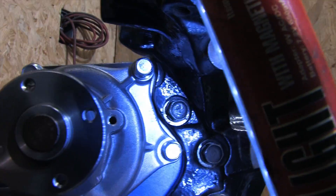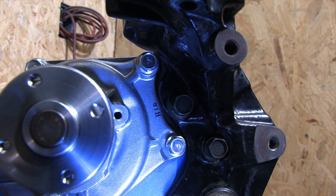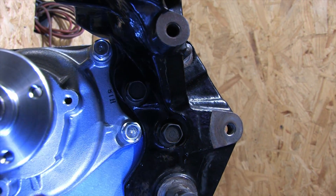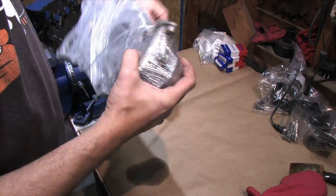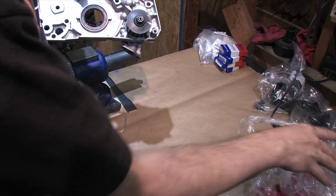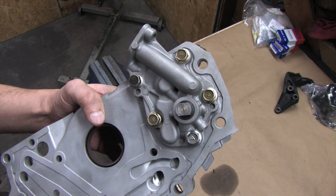That's a good fit. It's not touching anywhere, and I removed as little material as possible to make room for the water pump — about a 2.5mm gap in the tightest spots. You should paint or powder coat it once you're done because it'll rust if you don't. Consider the thickness of your coatings. Let's see how this front case fits with the 2G mount. We rebuilt this thing in a previous video, and I left myself a note to torque the oil pump sprocket nut to 29 foot-pounds — let's go ahead and do that right now.